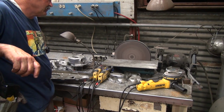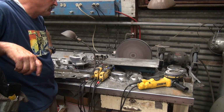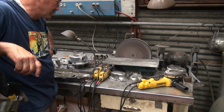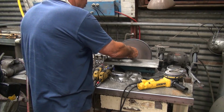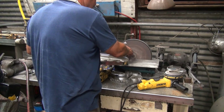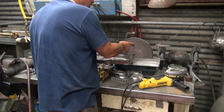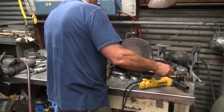Now, if you look at the grinding disc, it's damaged. See that white spot on the outside edge? Yeah, don't put your hand on it, but you see that going in a circle right there? Don't put the primary in that area. You might wind up wearing the primary cover, if you know what I mean. It has some issues. Brand new disc. Look at that little spot right there. Now if you stay off of that area, it works good. If you get in that area, you might have some issues. I think you got a bearing issue going on? Maybe. If you take the primary cover and flip it over so the flat side is down, it probably won't hit you in the face either. Okay, you got all the important parts figured out now?